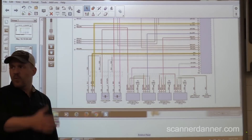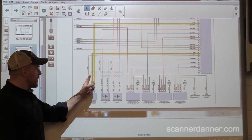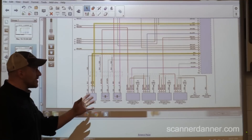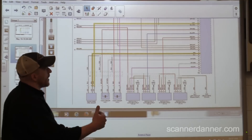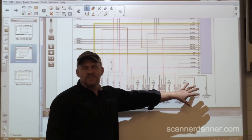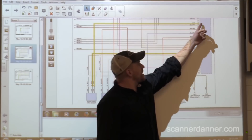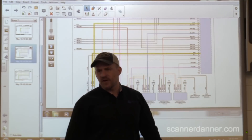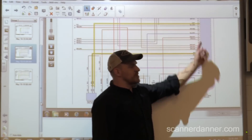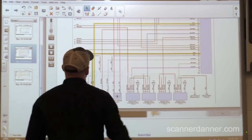It's just a wrapping around the wiring, and I believe that's what this is. The dotted line shows those two wires are shielded — that's the signal and the signal ground. I think it's going to be a sine wave for the crank sensor. The only reason we picked the white wire as crank sensor positive is because the other brown wires are grounds. I have no designations inside the computer — welcome to the European market.